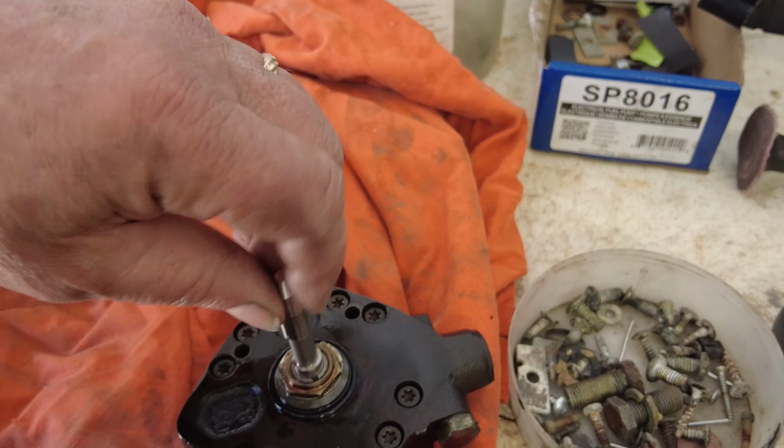Yeah, so there's that pressure release valve, and there's the spring and everything that goes with it. But there's supposed to be a ball bearing, right? A 19 ball bearing. And I don't see a ball bearing. Nothing came out of there, so I'll have to do some hunting around, see if I can find a ball bearing that'll fit there. There's lots of stuff that'll make a difference on the fuel of this thing, eh?